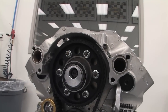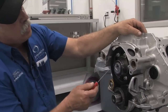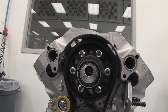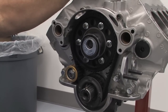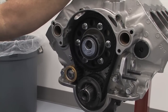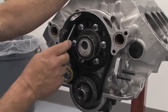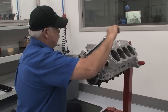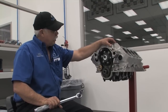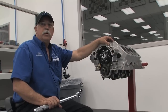One of the really great features about the Roush Yates belt drive system is the way you can adjust cam timing. Once everything is snugged up, you can loosen all the nuts, then adjust your camshaft — move it back and forth to get your cam timing where it needs to be. You've got a pretty wide range of advance and retard. Get the camshaft right where it needs to be, lock it down, Loctite these nuts, and torque them to 18 foot-pounds. And there you have it. Your front drive is on and you are ready to complete your engine — get your rods, pistons in, pan on, heads on, and your engine will be ready to go.